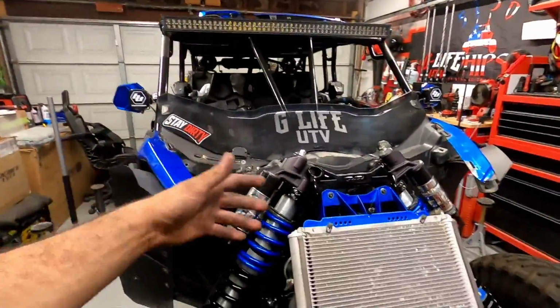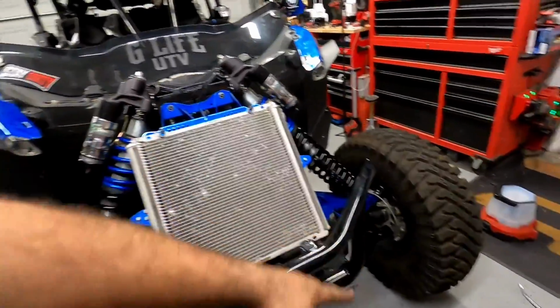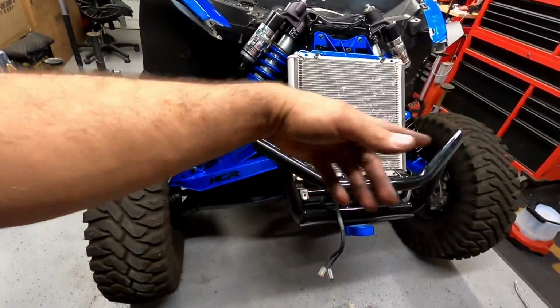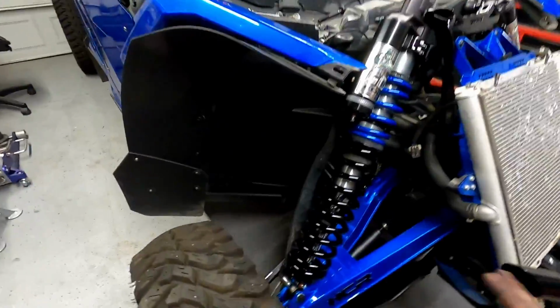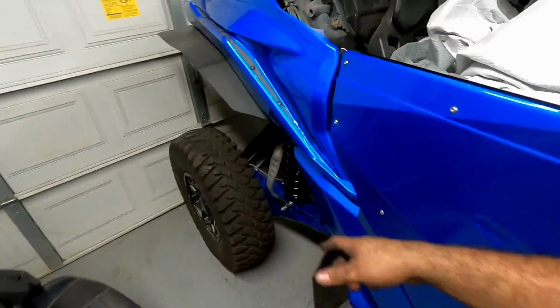I mean, I haul ass on it, stuff gets jacked up, the shocks were getting hot, this melted. I mean, the ball joints were kind of needing service. The arms had gouges in them, and I cleaned them up as best as possible. Snapped axles in the back. Although these radius rods, the heims are still good.